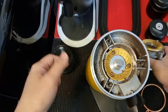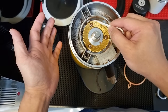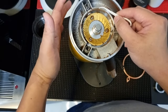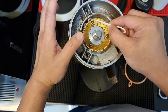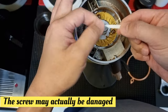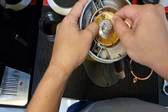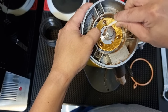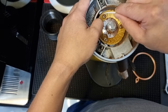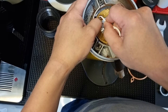Since I'm going to remove everything, most of the time all these tiny spaces between the screw will have been filled with coffee ground — that's perfectly normal. In order to unscrew the screw properly, I have to make sure all the coffee ground has been removed, otherwise I won't be able to effectively unscrew it. So just get something like this plastic toothpick and make sure you remove all the coffee ground as much as possible before you unscrew. It's plastic so it won't damage the metal.